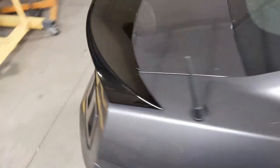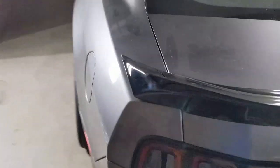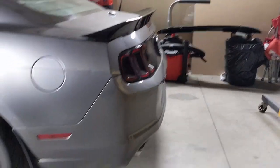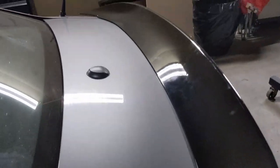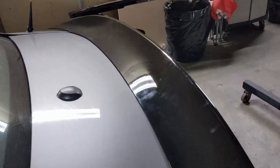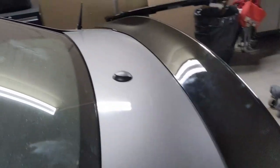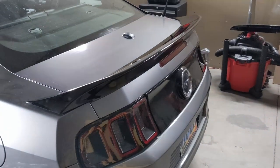So if somebody wants to go through and re-drill some holes and put some nuts in there, it would still work — it's still to the shape of the car and it still looks good. But I got a different one. The other one was a GT500 style; this is more of a ducktail style, and I almost think I like it a little bit better. The holes on this one fit and it has a nice profile. I kind of test fit it just to make sure the bolts go in the bolt holes, which they do. I need to put a little bit of cushion underneath it so that it doesn't wiggle as much, and a little bit more on the back so it sits forward and flush. It's actually a really, really good fit for how cheap this one was. So I'm going to go with this one.